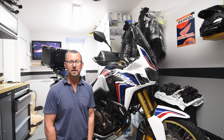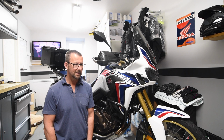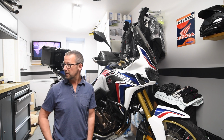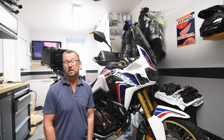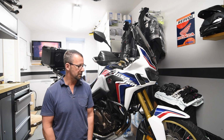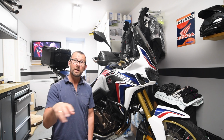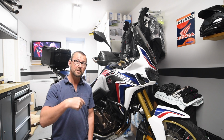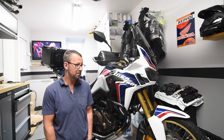If any of you have changed a tyre in a tube before, even in the lovely garage like this, nice and heated, lovely lighting, with no pressure whatsoever, it can bring out the devil in you when things don't go your way. So I think maybe I've just been a little bit too over eager on spooning over the tyre levers, etc., and I've just cut the tape at the top of one of the spoke heads, which has caused the leak. So I had already done an introduction video to what we're about to do, but I've now redone that, and this is the one that's going to be the introduction video, just to show that things don't go the way one would expect all the time.